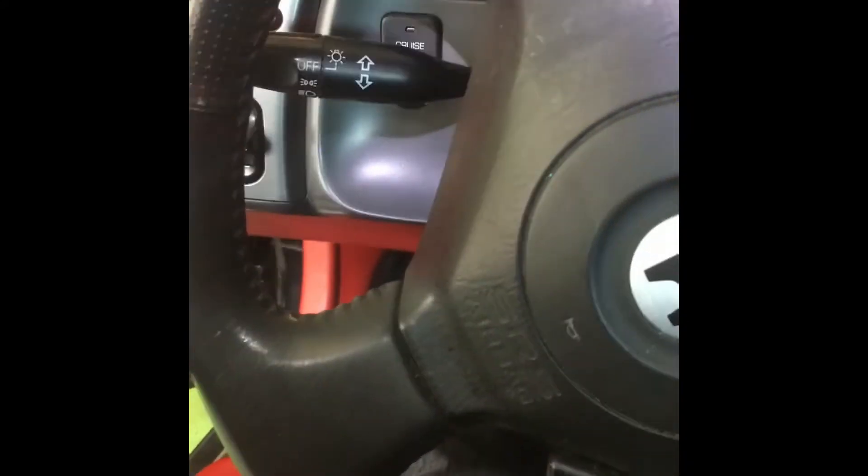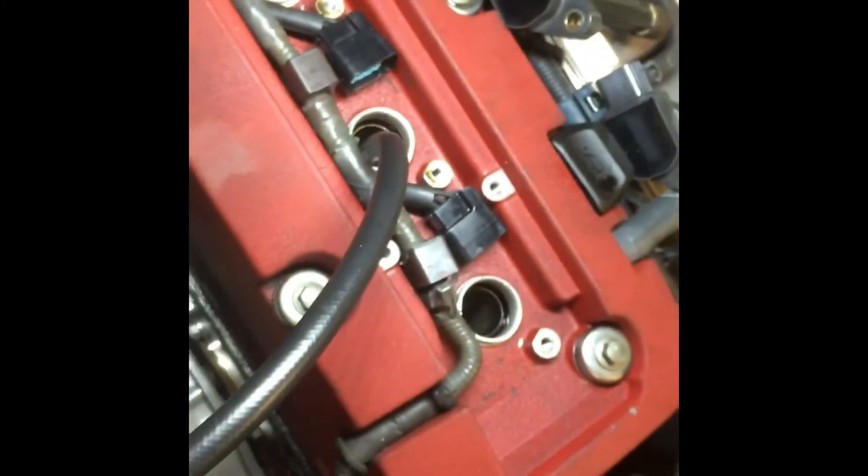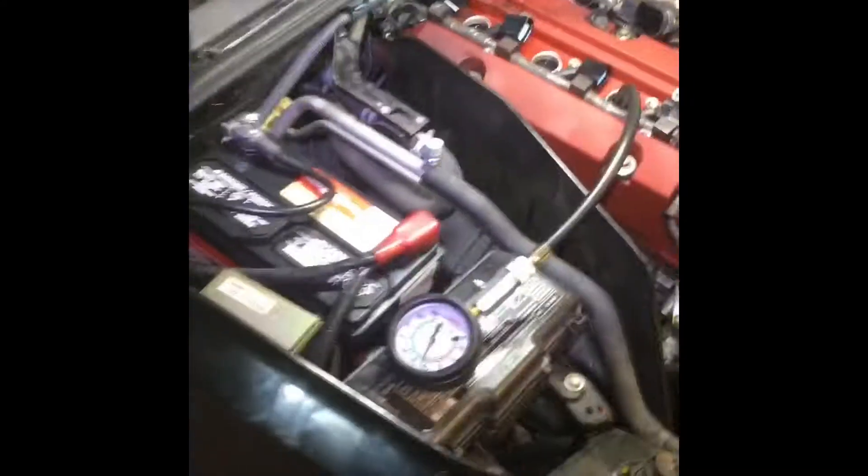Here's cylinder two. It's the affected cylinder that had the spun bearing on the crank. We're down at zero again. Let's see what she does. Just a little less than the one before it, but I might not have that thing as tight as I could. It's got troublesome getting the first one out. On to the next one.